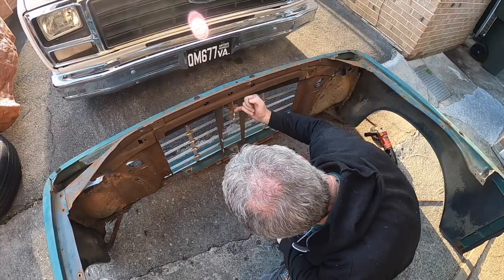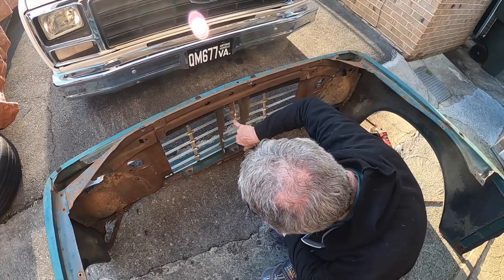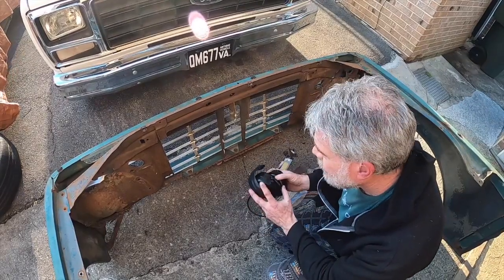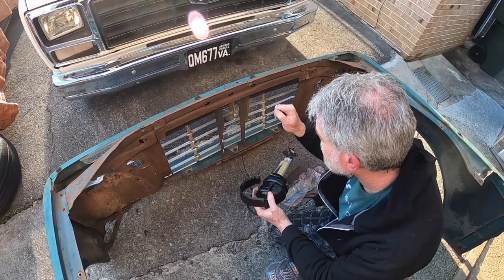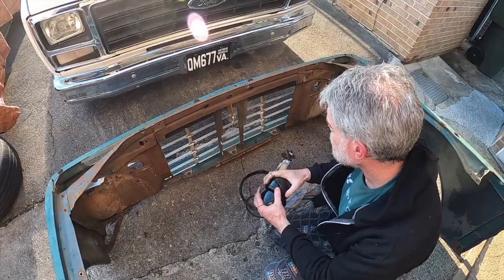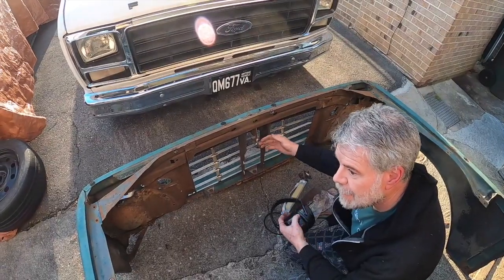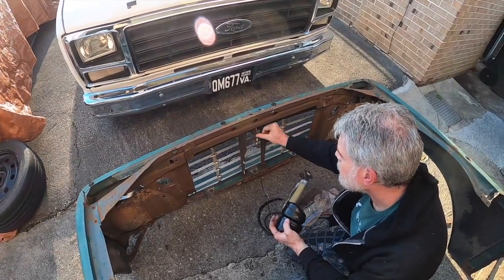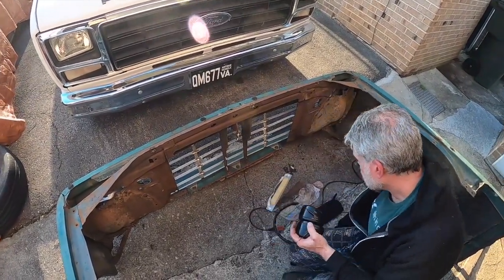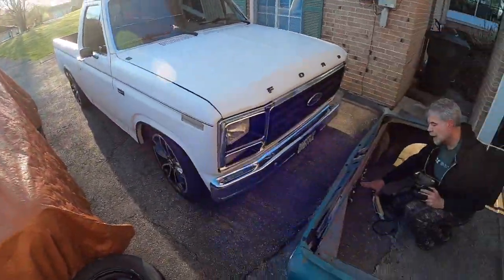And then on this, that's that handle I was telling you about that you pull to release the hood. We've got to cut the back part of this off because this is about to hit the Crown Vic radiator. When I did my blue truck, I mashed the radiator out and had to sit there. I wish I'd had one of those little combs, the tool made to straighten the fins back out, but I did it with a knife and straightened those out. To keep that from happening on this one, we'd already trimmed a little bit. I don't know if we showed that in a previous episode, but I had already cut some of this off. I'm going to go ahead and cut these two things down a little bit more, and then we'll give it another shot. I need to check how close we are at the bottom to the actual radiator.